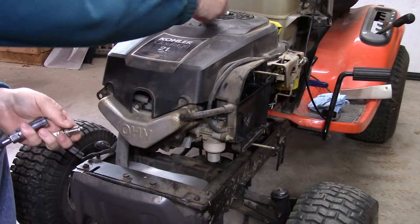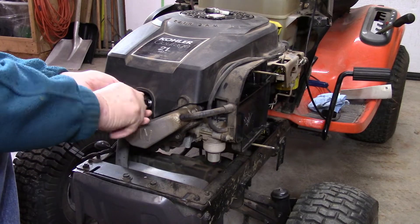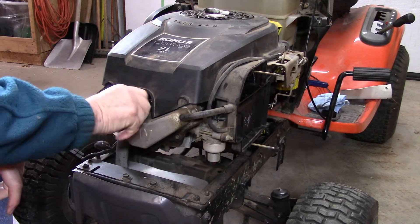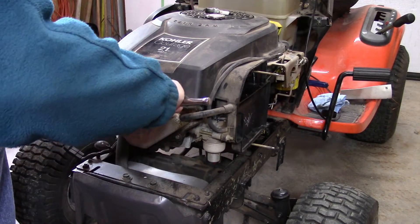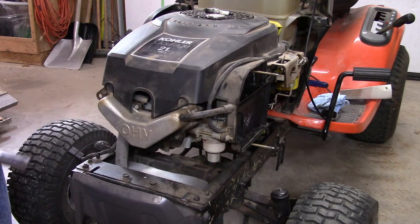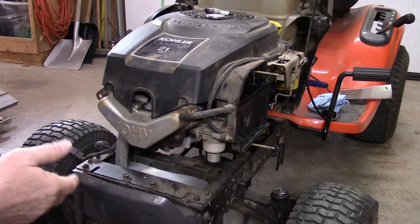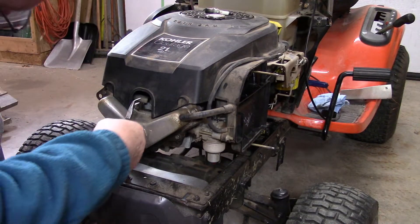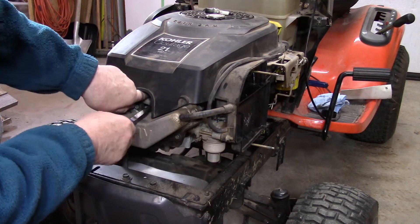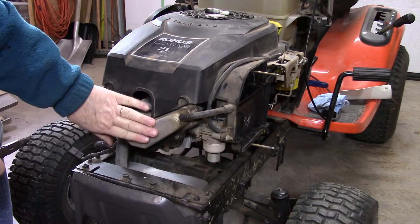That's good at 30 thou. We'll insert this plug. Since this is an unknown commodity — not sure if it's going to be a good one or bad one — I'm going to keep an eye on it through the summer. If it starts to deteriorate or show signs of problems with the engine, I'll know not to use this brand again. Since it came with the maintenance kit, I thought I'd try it. I'm not going to do anything with the valves because I adjusted them last year and everything is still okay there.